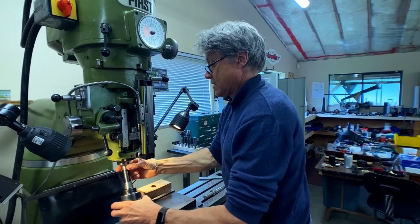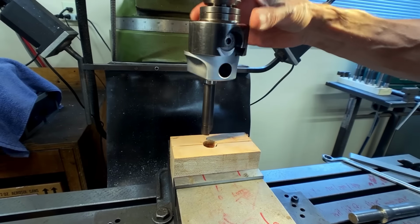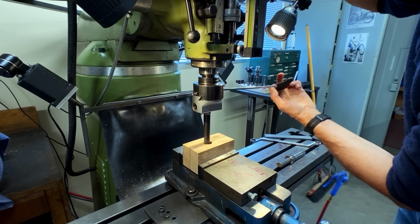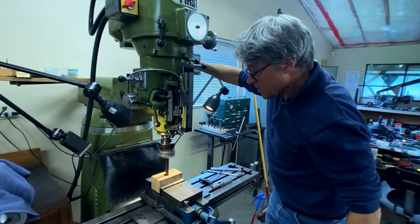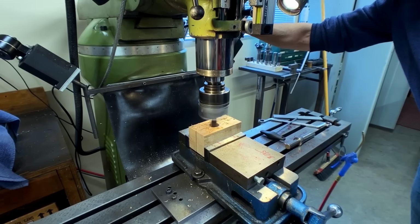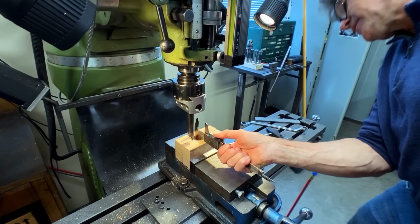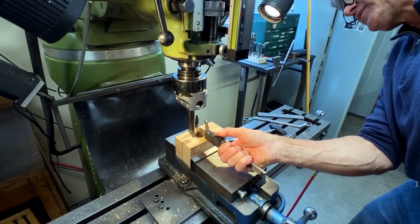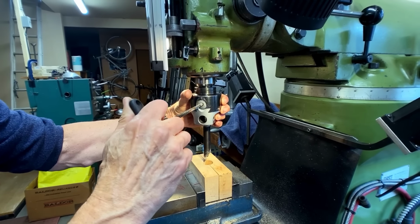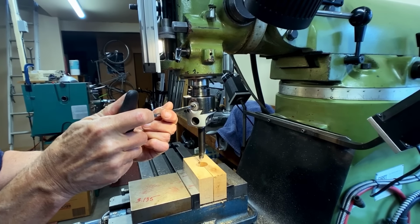Boring bar in. So it's obviously way too big. So what I have to do now is to grab an Allen wrench, and I can bring that in about an 1/8 inch cut. That should be good just to start with. So looking at this, I've got 76 thou to take off. So I got 10 thou up to the 0. So I go to the 0, and then if I go 66 thou, that's my 76.